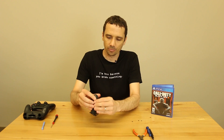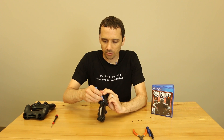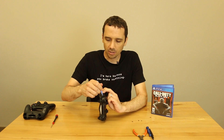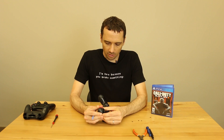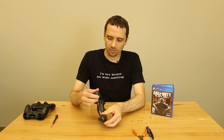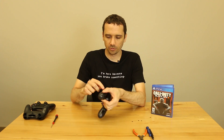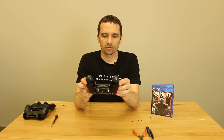The next thing we want to do before we worry about the clips is loosen the case a little bit. I'm going to take it with my fingers and just pull up like this — you can see there's a gap right there, enough for me to get my pry tool in. I'm going to get my pry tool right in the gap and then just slide it up there. You heard that one come apart right when I was about here. If it doesn't, just give it a little pry right there and it'll come up. Then I'm going to pull like that until I hear another one come loose. These two on the back will usually just come loose as you keep prying, but if they don't, we're going to pry up here. So we've got the controller loose — it's kind of apart.